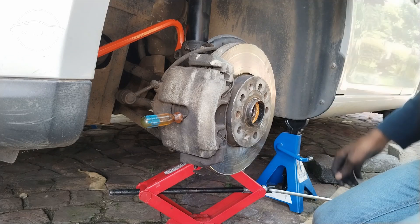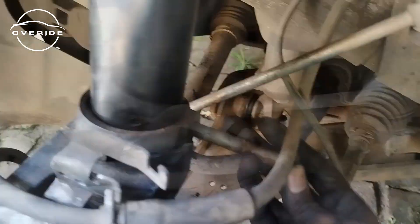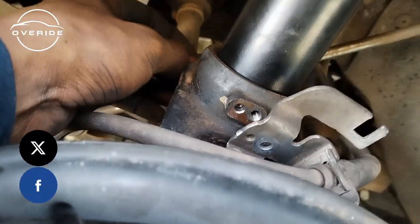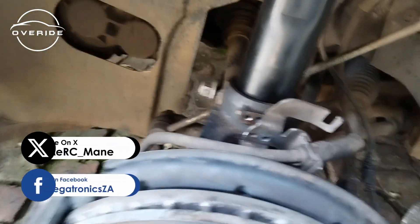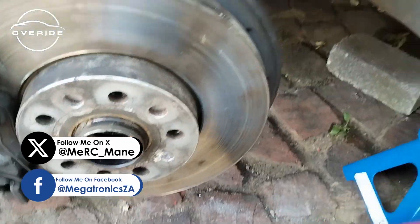The shock is in. Let me show you using a screw which goes in there — you can see the shock is finally in, it comes out through here. That's the trickiest thing — getting the shock through the knuckle. With the pressure of the control arm, the shock has no choice but to go down. We're done getting the shock in.